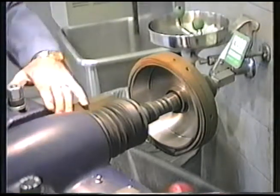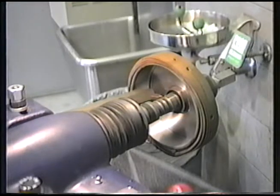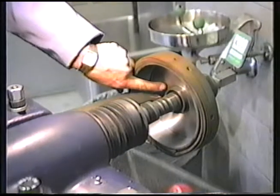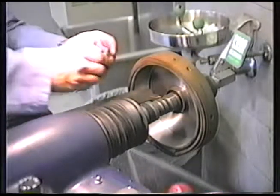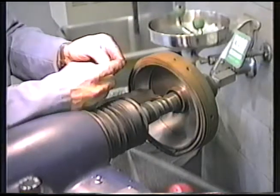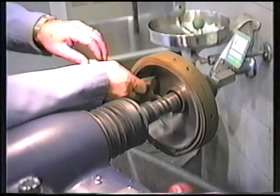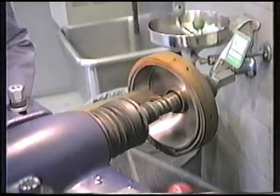And position it in. As you can see, you can work it one way or the other to get right at the edge surface in there. Now the tool that works best for that would be like a number 4725 positive rake bit. It's got a very sharp point, so you can get that tool right up against the edge there and work it on in as necessary to finish up. If necessary. I don't believe it is on this drum.